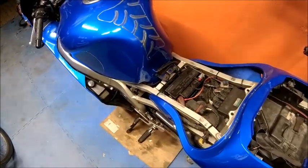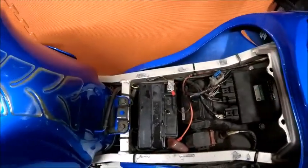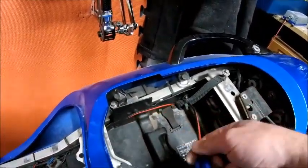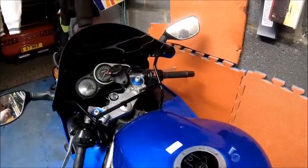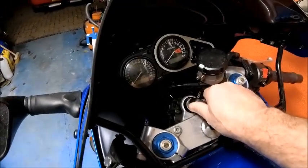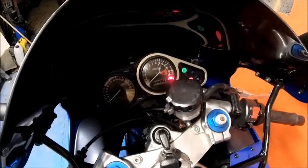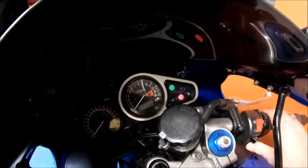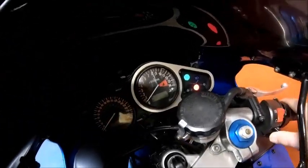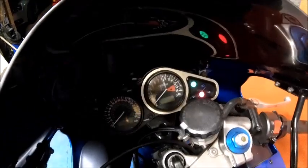The battery's back on and all connections are on. These extra wires are for the charging points — once the seat's on you have to take it off every time to trickle charge, so I've put an RC connector on that goes into my trickle charger. We did get a bleep from the alarm. Switching it on — it's better. I wasn't getting any lights before. We're getting a little click from pressing the starter button, so it's definitely improved.